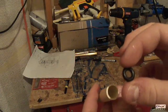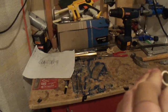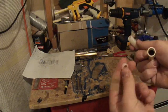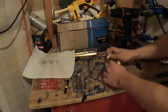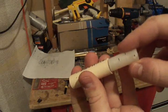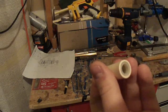Now that this is dry, take your O-ring and insert it like so. Make sure it goes in the right end — the two-centimeter end — or else you'll have problems and you'll just have to start over. I'm just pushing it in with a Sharpie here — it works. After that, take one of the other half-inch nylon pieces that are .75 centimeters long and insert it in the end once again — which can be a challenge. Do the vise process again, except mark 1.2 centimeters away and push it down until you're at that mark. That should be right at the edge there. Then you can move on to gluing this.